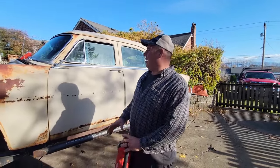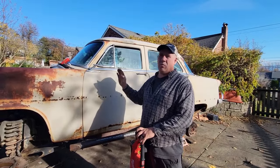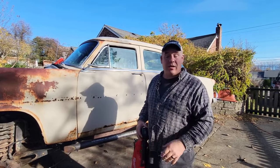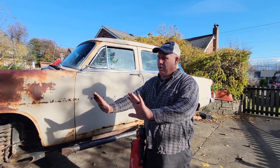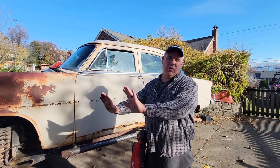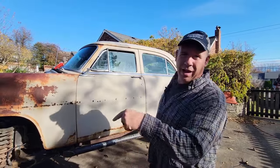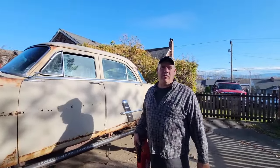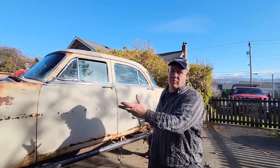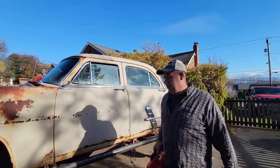Okay, so we cut off the video yesterday when we were messing around. You probably don't see, but we'd pushed the pedal. Our alignment seems right. That 1 inch that we were talking about was correct, because I could push that in finally with my bar. I had the pedal down, and Mary says the pedal goes further than the rod, and the rod was bottomed out. So we should have the brakes. We're not getting any head pressure. We're not getting any back pressure. So now we've got the wheels off. We're just going to try the old traditional bleeding of the brakes, because you guys saw that I emptied that rust. So it's very possible that I have a bunch of air in there. So when we saw that, I was like, hey, let's blow these off.